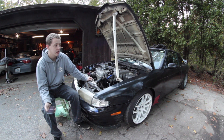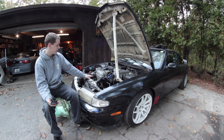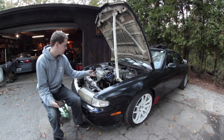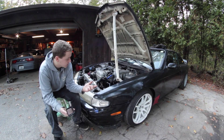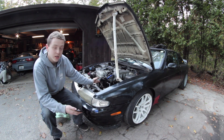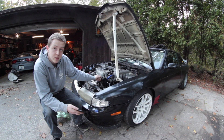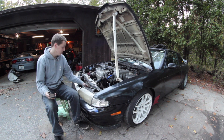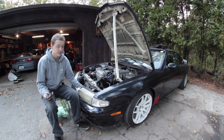The radiator came from a buddy's SR-swapped car — he gave it to a kid named Nate, Nate never used it, so I got it back. We have an SR radiator in there now. The radiator hoses are just stock SC300 hoses and they fit up perfectly — you have to cut the top one a little bit. For power steering, the factory S13 hose bolts right up to the 2JZ power steering pump, so that's perfect. I also got a power steering oil cooler for free.